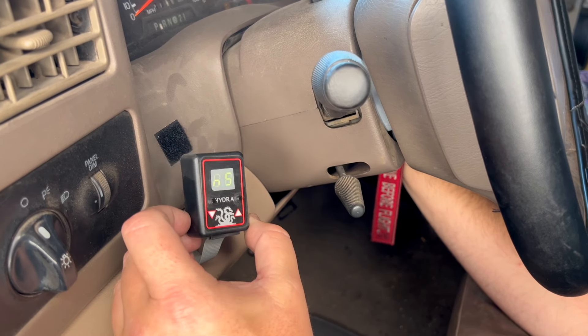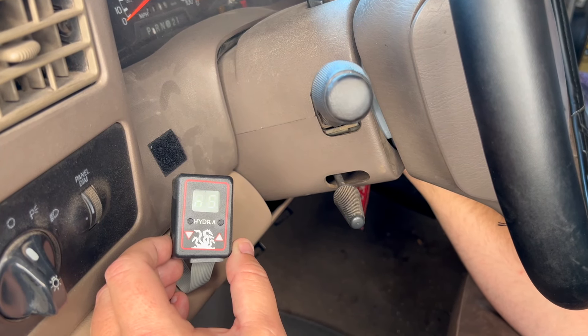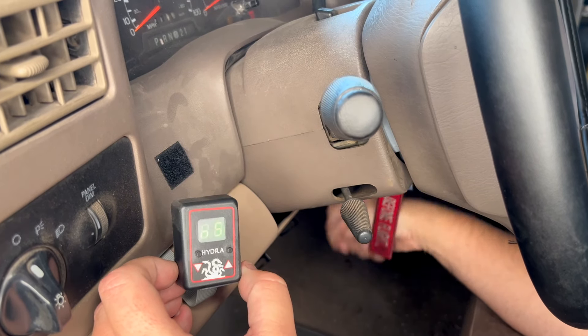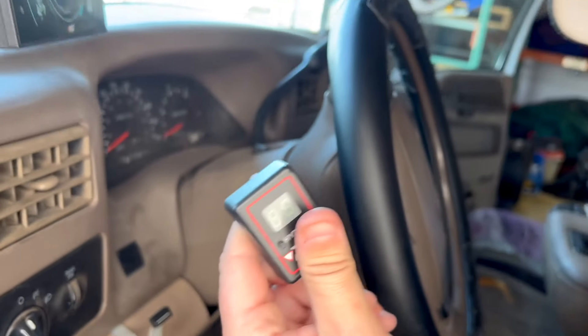So we have the tune in no-start right now. This truck does not start — we'll crank it again. It's not working. So this truck is in anti-theft mode. That selector just plugs in right here as you saw it. You take this, put it in your pocket, throw it in your glove box. This truck will not start unless this box is put back on there and changed out of no-start.